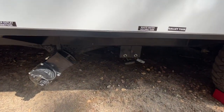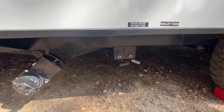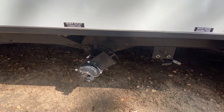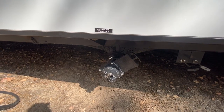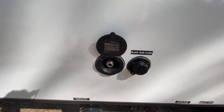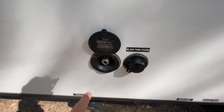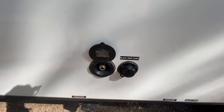A little further up we have the valves for the sewer. We have them both open right now. We installed the Nature's Head composting toilet and then installed a Valterra valve, so we can leave those two valves open and just leave this one closed, which gives us double the gray capacity. There's a black tank flush here and also a spray port — you can use that to wash your motorcycle or hose your dog off, though the water is not hot.